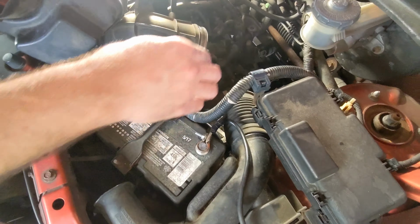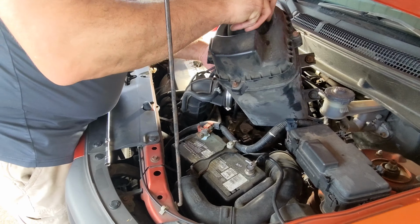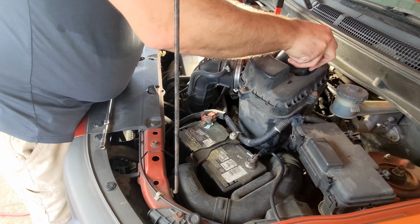And we also hooked, as I told you, down here on this one bolt, there's actually going to be 2 nuts on that. One is to hold the negative battery cable. As you see, it goes down and connects right in here. Whoop, my hand's in the way. Right here. So make sure you get that one back on. And then there's going to be a second one that actually holds the bracket to the transmission. So let's see if we can get this back down in here.